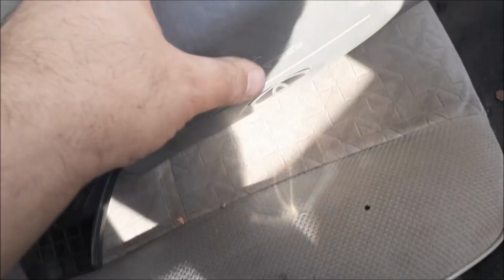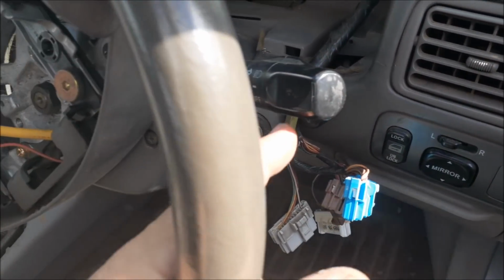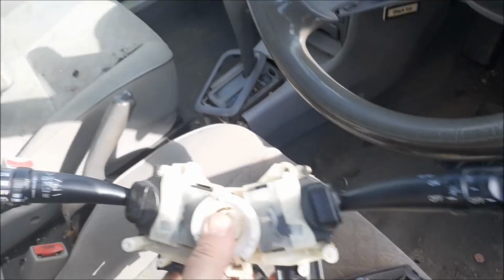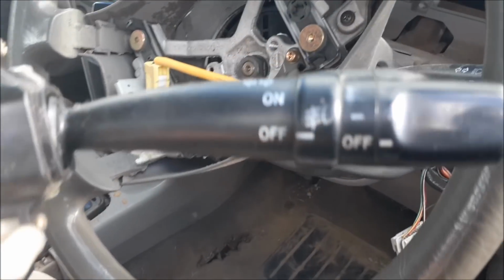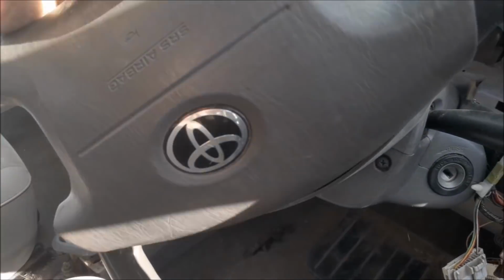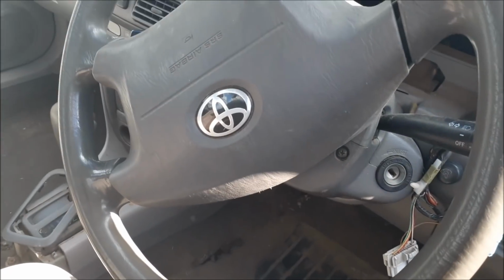That being said, this looks like quite a substantial airbag. The other thing is the combination switch. Graham said the indicator only turning right played up, so it's not the flasher can. I've seen flasher cans go on these things, but on this occasion I don't think they are. I pulled this out of that Levin, and it looks the same, and it seems to be more positive than this one here. But also it's got the driving light thing there, so on the off chance we do put driving lights on at some point, we have the right switch. So we'll just pop that back in, because we don't want kids mucking around with this stuff. I might just connect it actually, just a moment.